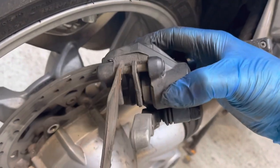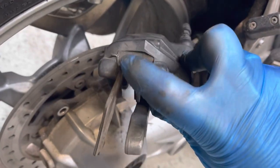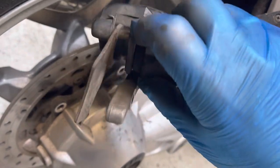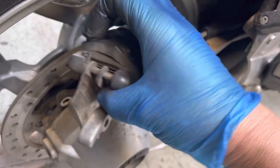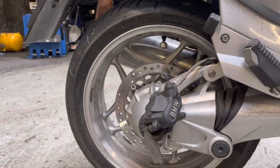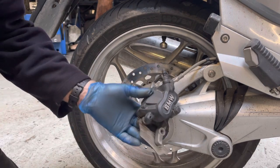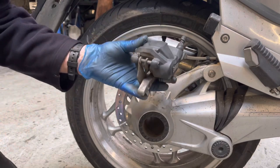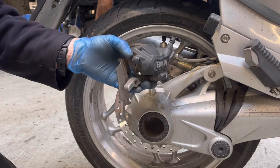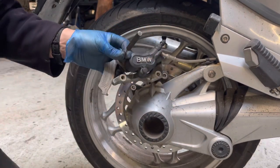You can see the little R-clip there — trying to do it one-handed but it's an R-clip that has to come off first. And that pin there knocks through this end here, out that way. So the caliper's off, we're going to take out the pin that secures the pads and basically we're just going to knock that pin through.